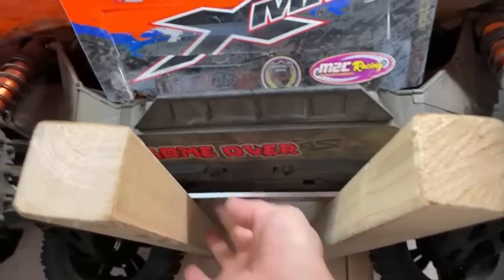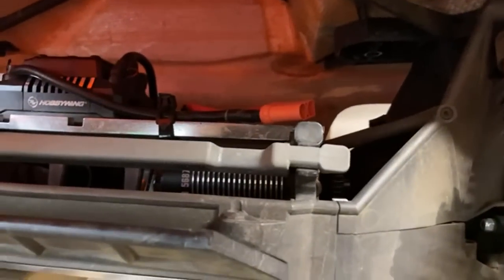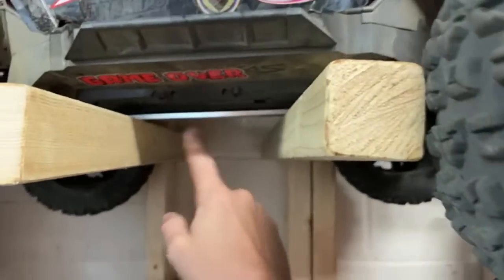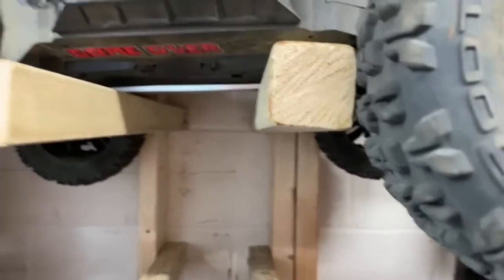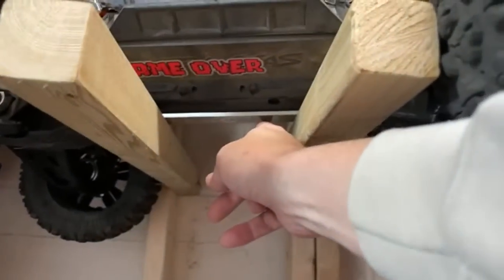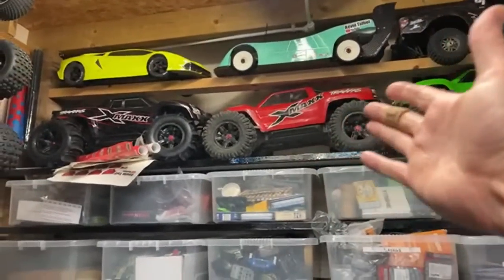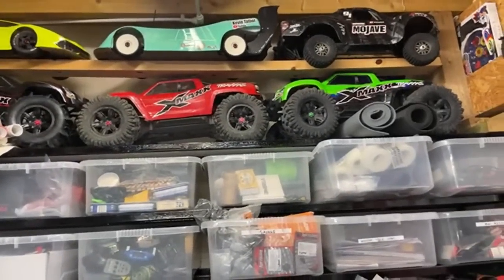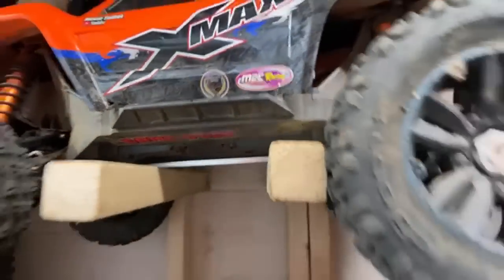Well, not everywhere, but you need a metal brace on the bottom, because otherwise, if you just put this metal motor mount system in, what I've seen happen is the chassis breaks in half exactly where the mount ends. And if you put this alloy brace under it, it ties it all together and makes it more reliable. But in my opinion, you're still best off leaving it fairly stock, not making it too much heavier, and just happy bashing. But for those people that want more power, you kind of have to go that way. So it all depends what you want.